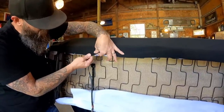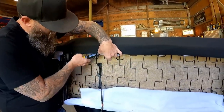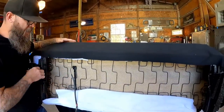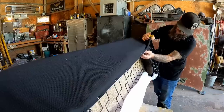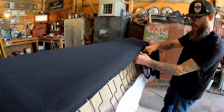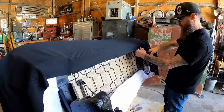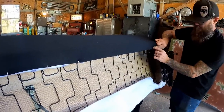I'm going to double up my material under here. There's a hole right where my thumb is. Take my pliers, put it right there in that spot, squeeze that — there you have it. That's your hog ring. Pretty easy to do. We're going to do that all the way across here, and then we can start to stretch our material on the other side and get it nice and tight. They're about every six inches there's going to be a hog ring hole. You could double them up if you want — I'll probably add some in each hole, maybe two or three of them. I noticed they did that on the factory ones.